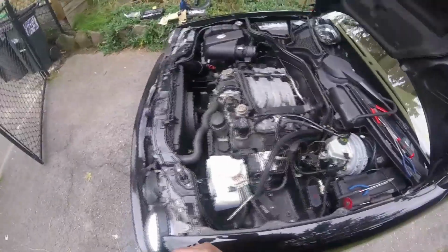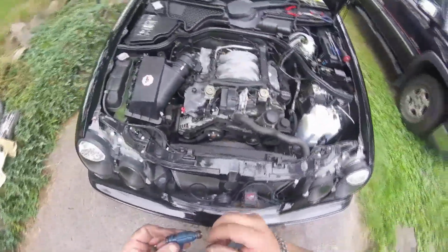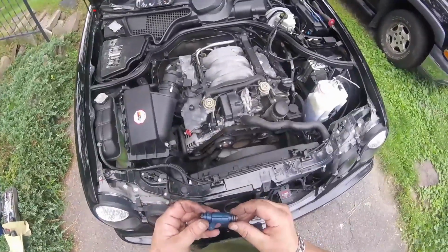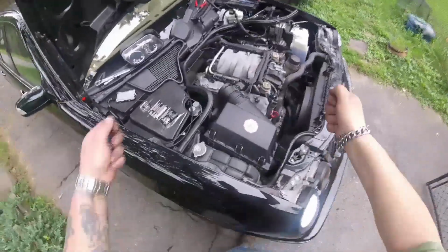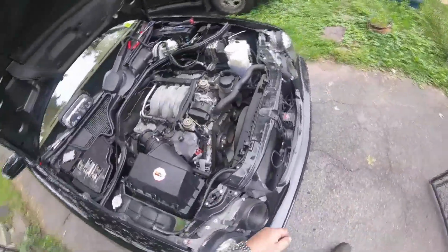It's safe for rubber. Do not use any kind of petroleum oil or grease. You will eat those rubber O-rings up. It has to be something that is safe for rubber O-rings, okay? If you need to lubricate them at all. When you put that fuel rail in, you're just going to have to work it in a little bit at a time. Make sure it's seated well, okay?